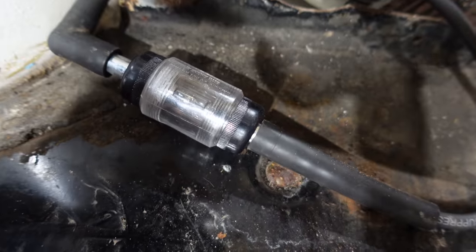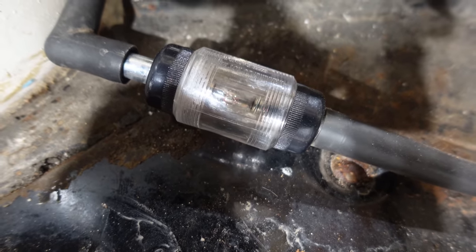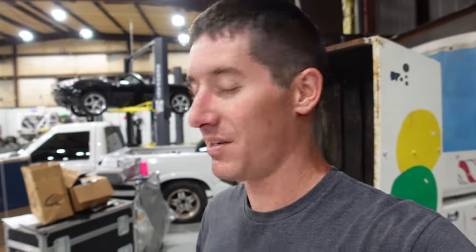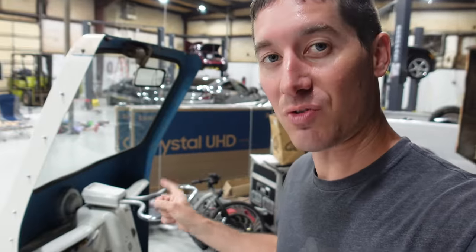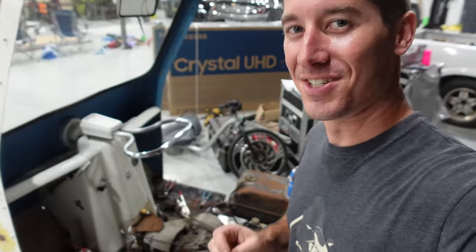Here's the spark tester. I'll start cranking right now. We thought that was some weird issue, like an impulse or something. There were probably some comments saying it was the ignition switch, and I was like, it's clearly not the ignition switch. But then when I was messing with it just a second ago, I realized the ignition switch is not keeping the run contact made while it's in crank. I'll show you how I figured that out — here's your headphone warning. Keys on, horn works. No horn when cranking. Obviously the horn runs off that run circuit off the ignition switch, which makes me think we're just losing our run connection, which is what's powering the ignition coil. So this should be pretty simple.